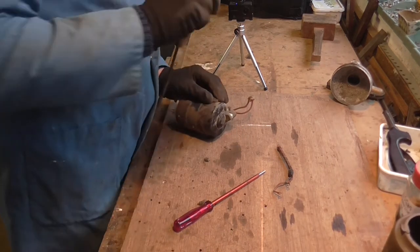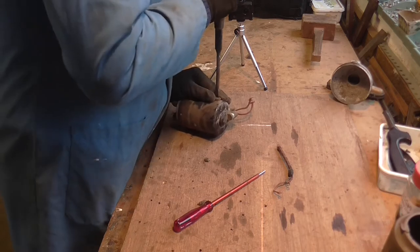You can get at the carbon brushes while I'm doing this. I'm just going to take one off — be careful that you don't break them, use a wide-bladed screwdriver. When you look at the carbon brushes on this motor, they're particularly shiny and nice. Clean, shiny brushes indicate that the commutation has been working fine, there's been no armature reaction and no burning of the brushes. If the brushes are badly worn in some places, that usually means either the armature is faulty or one of the brushes is sticking, causing it to lose contact and arc, which will eventually wear the armature out.